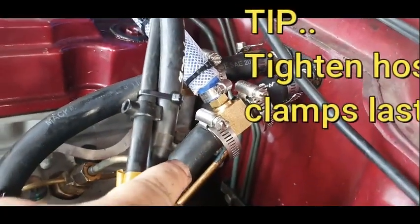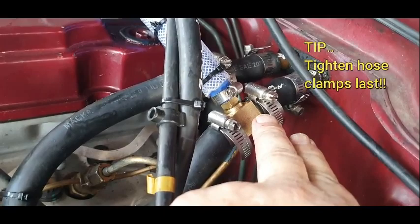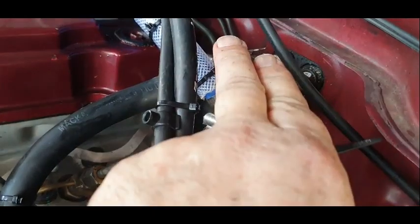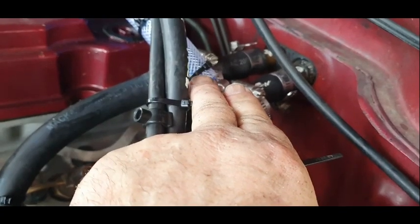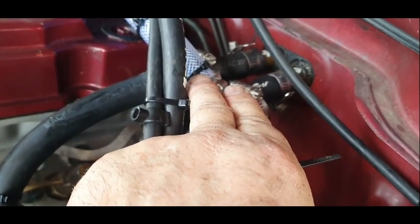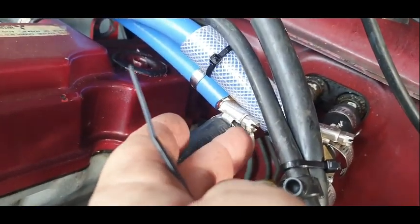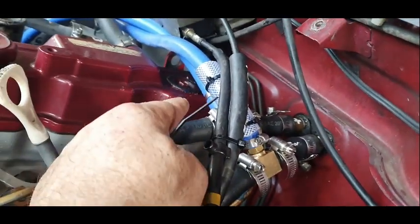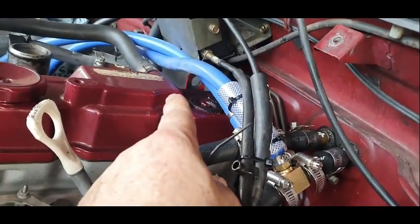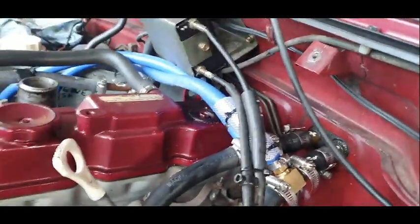So if you can see behind the mess, it's basically the heater hose here, the vehicle, a T-piece, the line going over the turbo. I've got this plastic, this white bit of hose. I've cut it and just put it around it as a shroud, a cover, because of the clamp there might rub it. So I don't want that to happen. And just cable tie things. It doesn't look the best, but yeah, it's gonna work. So I'll go around the other side.